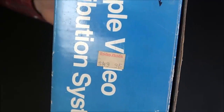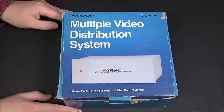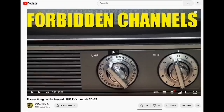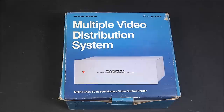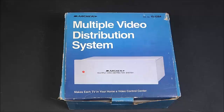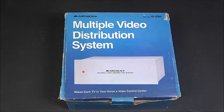Once upon a time you could go to Radio Shack and buy one of these for $49.95. The whole thesis of V. Westlife's video was that you were broadcasting on forbidden frequencies — the original allocations for channels 70 through 83 analog. Sometime in the 80s those got moved around, so if you hit channel 77 on a newer TV, that's tuning to different frequencies. You have to have old enough gear to get there. None of my TVs are quite that old, but I do have other video gear with tuners that are, so that was my basis for testing.